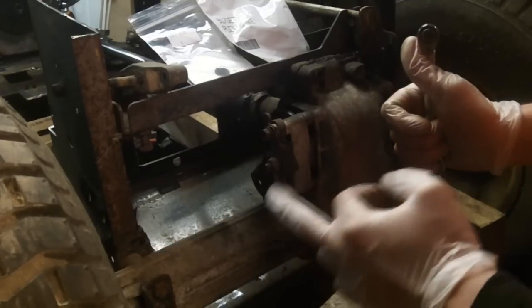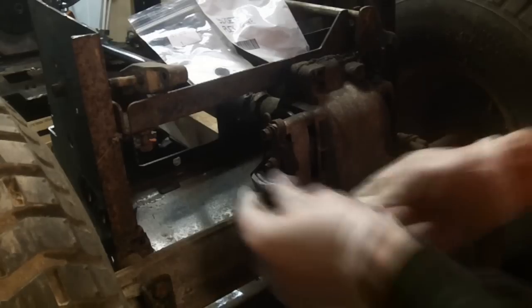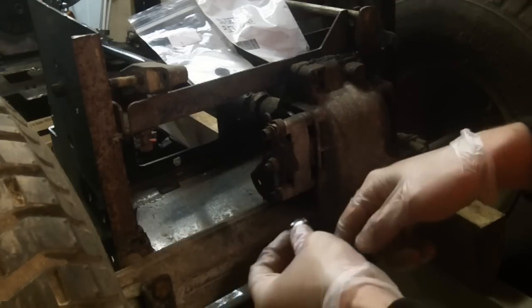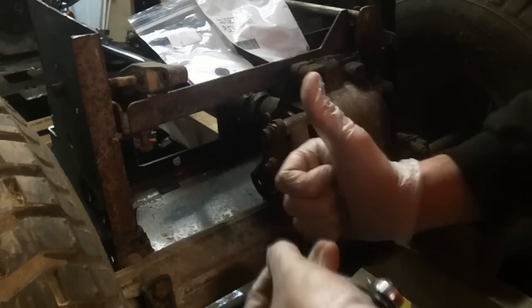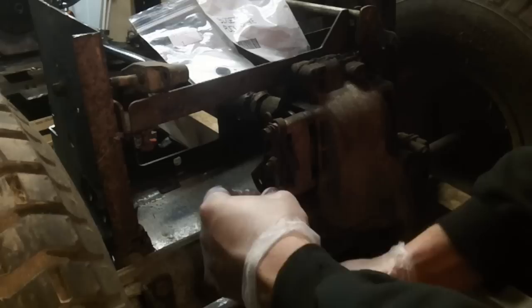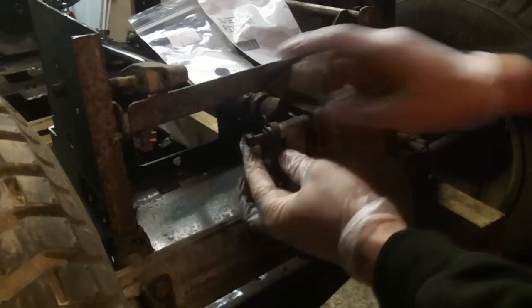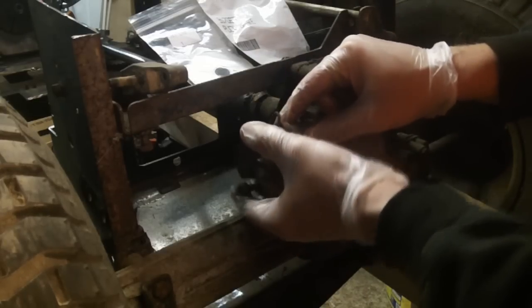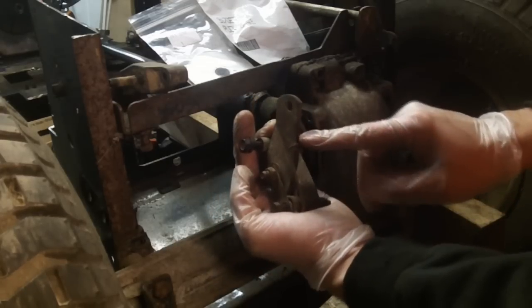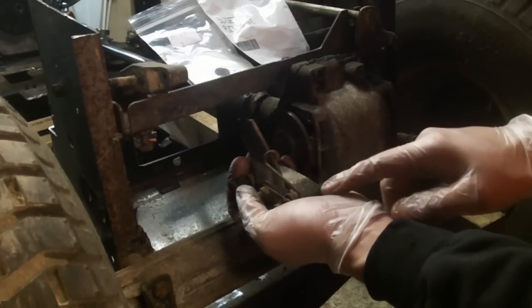For anyone having issues with adjusting your brakes later, that would be this nut right here, and it would be a half inch. If you go in this direction, your brakes get tighter; if you go out in this direction, your brakes get looser. When you take off the one that's right here, remember that it does have the spring assembly associated with it. The spring comes forward and drives the lever back into the neutral position, so be careful that you don't accidentally disengage it.